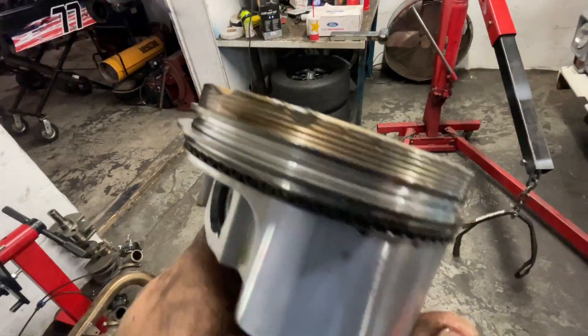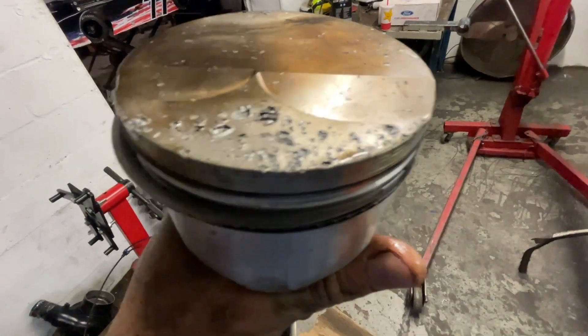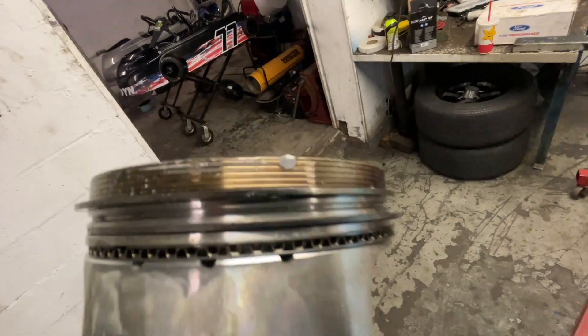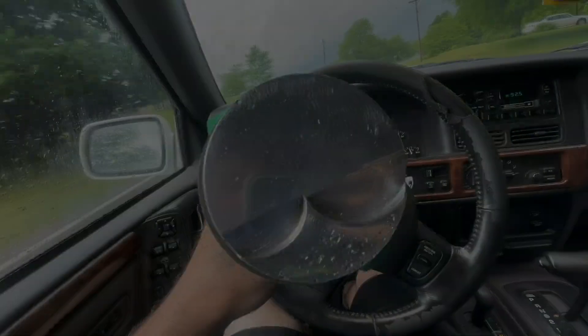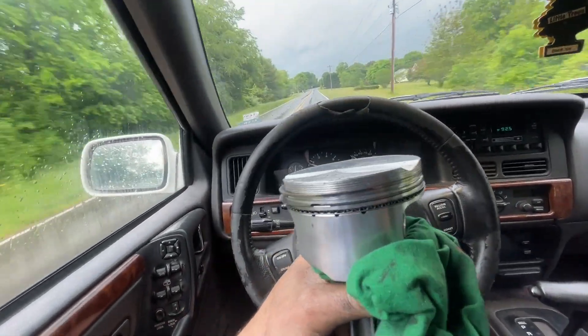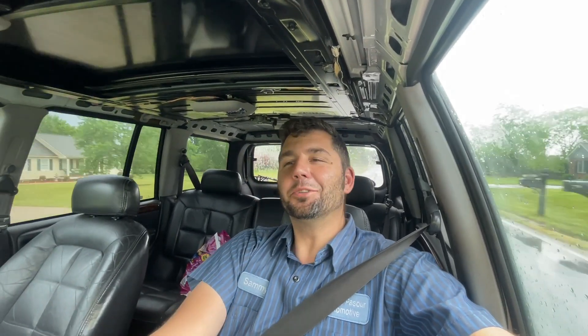So let's get this piston out here, see if we can't buff this thing up turbo John style. It took a beating around the edge of it. I think we can sand this thing out — as long as there ain't no metal I'm going to stick a magnet to it and make sure there ain't no metal beat down in that. If there is we're going to dig it out because it'll make a hot spot, but there's plenty of meat there. I think we can save this piston, see if we can't make it to the track Thursday. On my way back from Nigel's, hit it with a whiz wheel, knocked down the high spot, buffed it out, got it looking decent — it's not going to be bad. I'm happy it looks as good as it does.